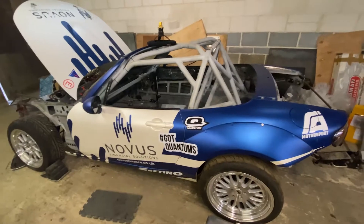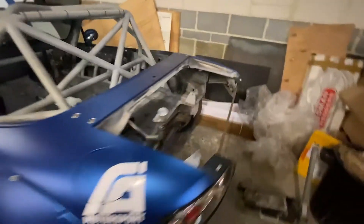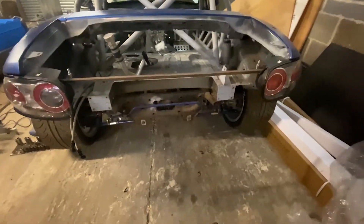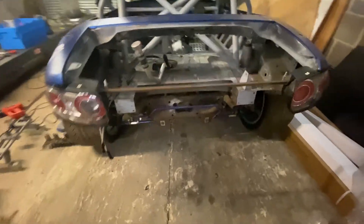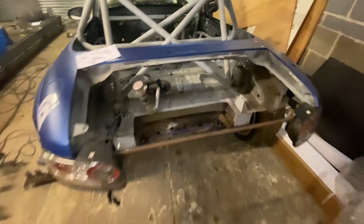I'm going to be making a spit for this car, which has got boltable plates for the front and rear removable crash sections. That's the rear there and the front two there — they're just a four-bolt pattern. They're both at different heights from the ground, so we're going to need some sort of adjustability to allow the spit to go up and down so we can balance the car.